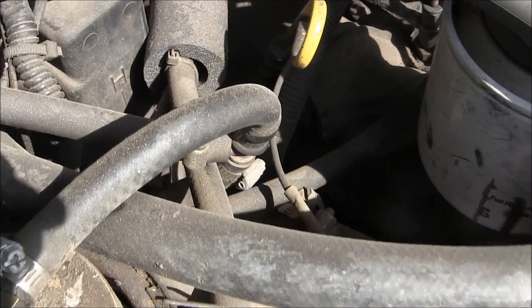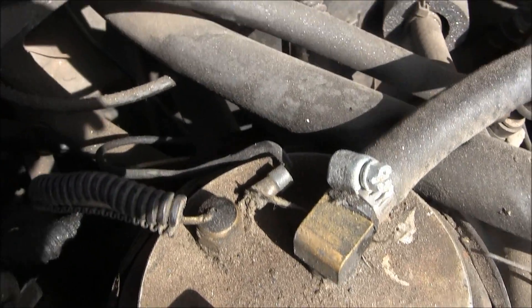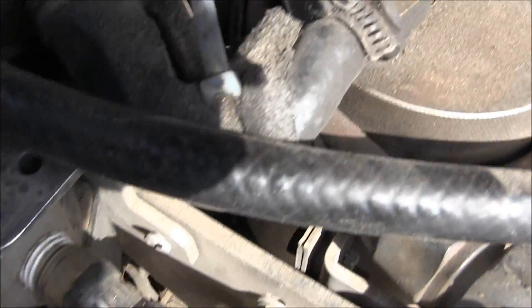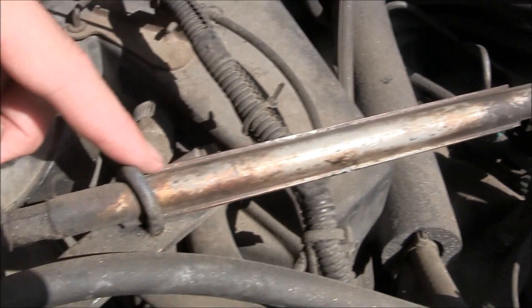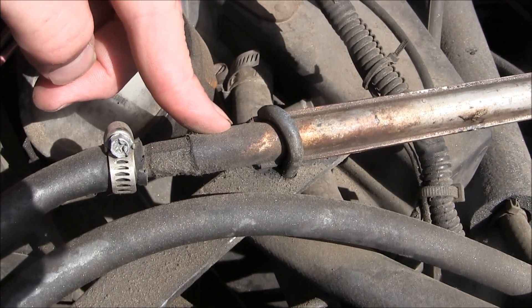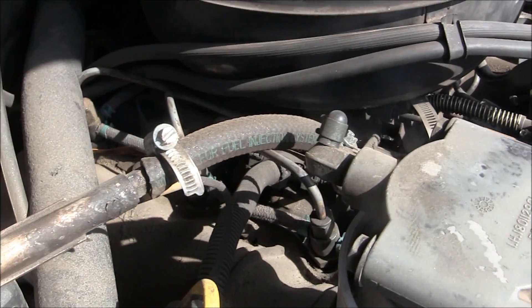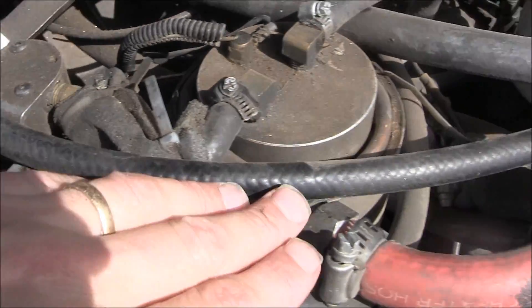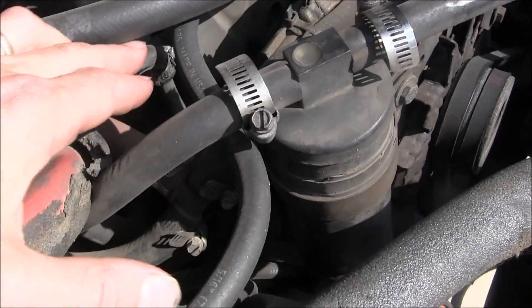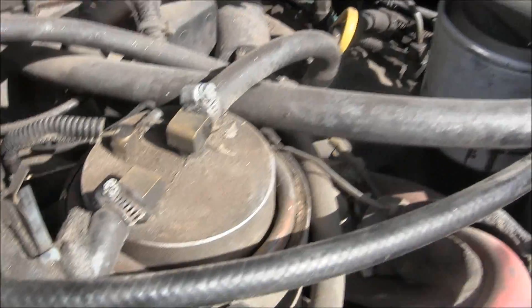The fuel runs from the lift pump down here, which I use to draw the oil toward the injector. Then I have what's called a veg therm — an electronically heated pipe that makes sure the oil going into the injectors is really hot, because it may have cooled off a little bit, especially on really cold days, from the lift pump all the way to the injector pump.